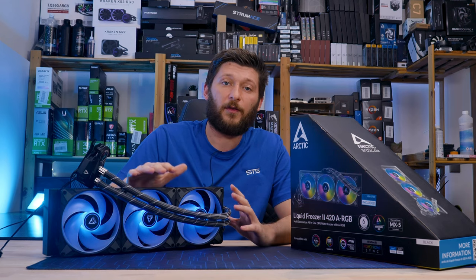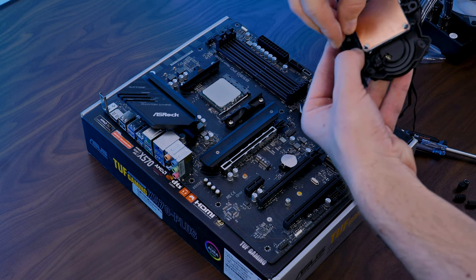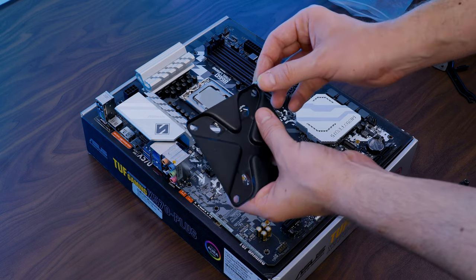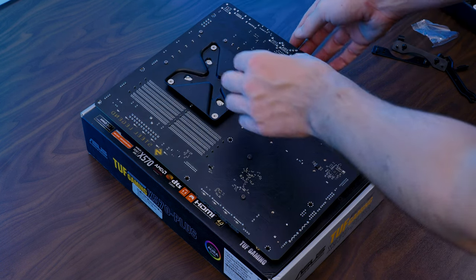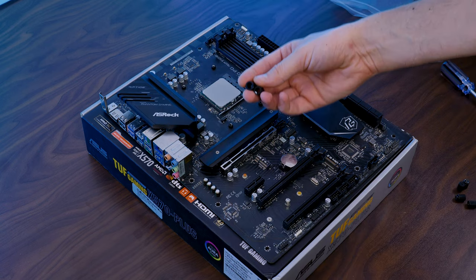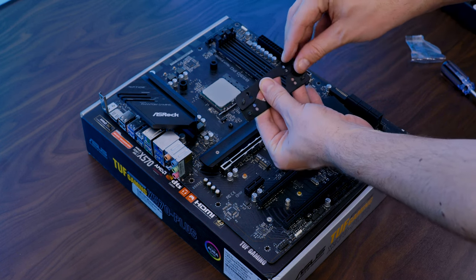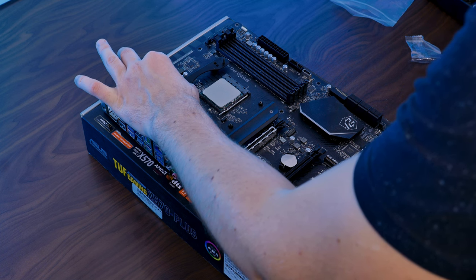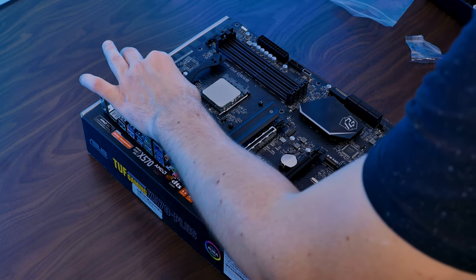Installing the AIO is exactly as it was for every other Liquid Freezer. First, place the two rails onto the bottom side of the water block with the ends pointing away from the center but the edges of each rail pointing up, then screw them down. For LGA 1700, take the provided backplate with the central part sticking up, shove the little screw holders into the outermost holes, and secure them with the rubber o-ring. After positioning the backplate behind your motherboard, take the Intel standoffs and screw them in. On the AMD side, remove the pre-installed retention brackets, replace them with the spacers, then position the AMD mounting clips on top — the one with rounded edges at the top, the one with sharper edges at the bottom. If you're using AM4 or AM5, use the upper holes as this pushes everything slightly down and can greatly increase the AIO's performance, then screw them down.